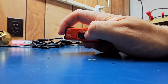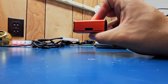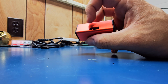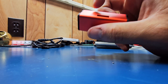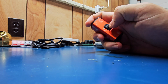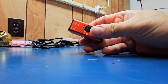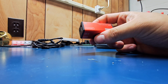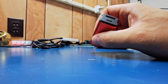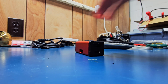The switch on the top is a two-position switch and what it does is it actually switches this USB port on the back between the two sides. So you can throw a small USB key in here with boot ISOs, and if you need to add another one, all you have to do is click it over to your computer, dump the ISO on, click it back over, and boot off of it — it's that simple. Unlike the nicer nano KVMs and the networked ones, this does not have the ability to image the device. You have to plug a USB in if you want to get images across.